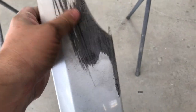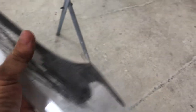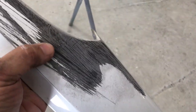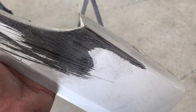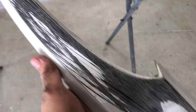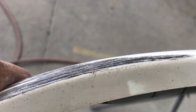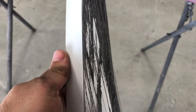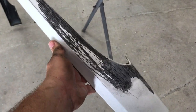I went over this with some 180 and these are pretty deep scratches. Remember how I said don't sand raw plastic with 80 grit because it hairs it up? This might be the exception because it's already haired up, and the 180 is going to take a long time on these deep scratches. So I'm going to jump on this spot with some 80 grit. Since it's already haired, I really can't make it hairier. What I mean by haired up — there are little bitty fibers of plastic sticking up.